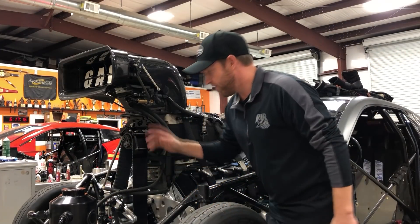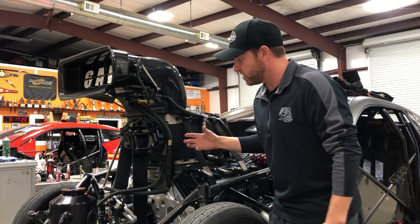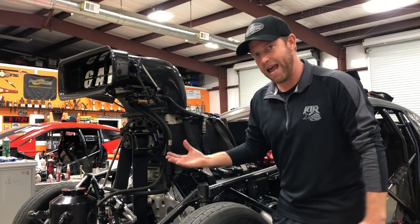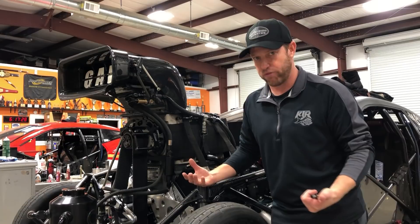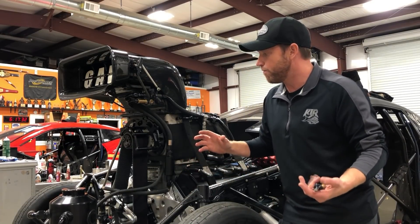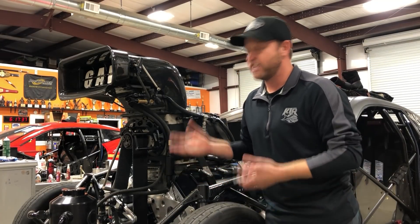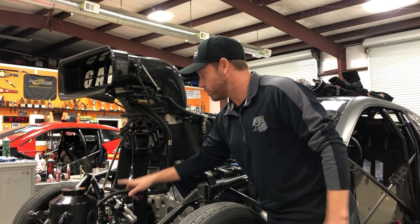Now on the car, the fuel pump is mounted to the front of the engine. There's a fuel pump extension that bolts to the front of the cam drive, and the fuel pump turns at one-half engine RPM speed — it turns at the speed the camshaft rotates, which is 50% of what the crankshaft turns. The fuel pressure and flow curve is linear depending on engine RPM: the faster the engine spins, the more fuel it makes.